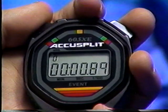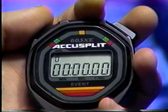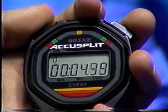And the 8030B retains these favorite features. Parking light flash, which also shows alarm tripped warning, starter cut relay, and disarm valet switch. In the passive mode, the system will arm in 10 seconds. But with extended exit arming, the system will reset its timer if a door or trunk is opened, and restart the 10-second timer when the door or trunk is closed. Then it will arm and lock automatically.